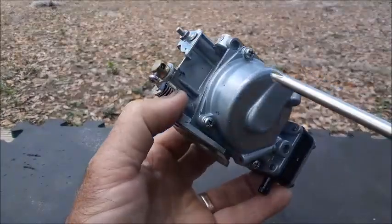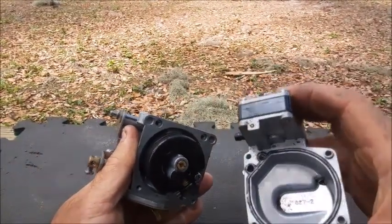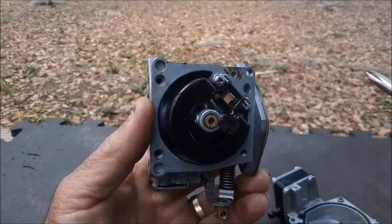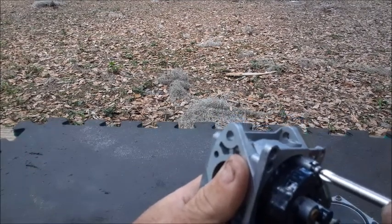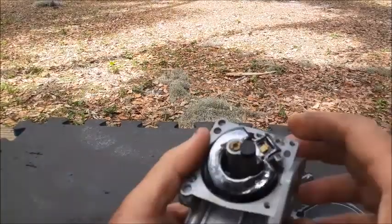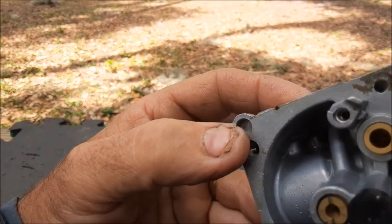Next we're going to take the bowl off the bottom of this carburetor. There are basically just four screws on the bottom — take those out and the bowl will just separate off the bottom. You can see there's a float valve right here. This float valve goes up and down to regulate the amount of gas going through the motor. We can see the problem here — the needle valve doesn't appear to be dropping down whenever the float goes down. We'll go ahead and remove this needle valve to see what's sticking it. It's probably got a little bit of crud in it. Take out this one screw right here and that will release this rod that holds the float on. Remove that screw, this rod basically pulls out of the way, and there — just pop the needle valve loose. There might be a little bit of crud in that brass needle valve cylinder, so we'll get all that cleaned out and hopefully that resolves our problem.